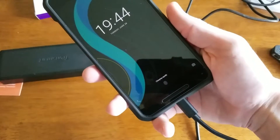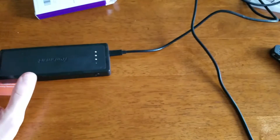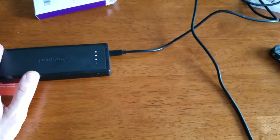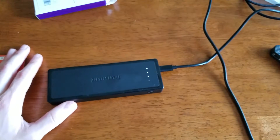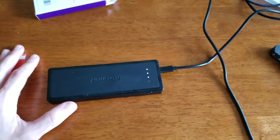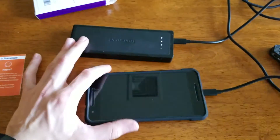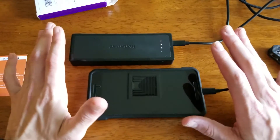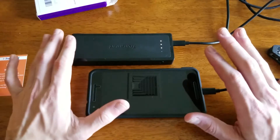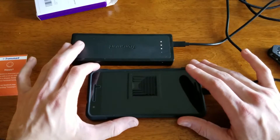This cable is doing what it's designed to do — charging the phone rapidly, probably at the rated 5 volts 3 amps. Unfortunately, the only way to really test that accurately is using a USB Power Delivery monitor, which is Type-C to C, and a computer with a Type-C port, and I don't have one of those. But I'll do my best to test this, checking with an app like Ampere, which isn't as accurate but will give a good baseline.